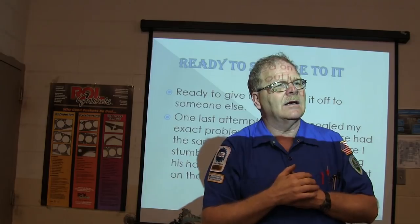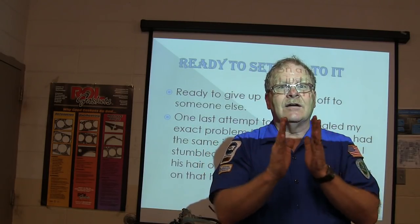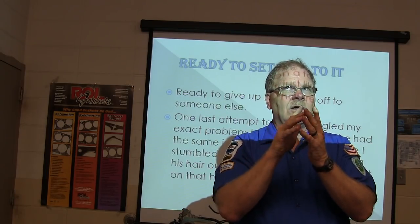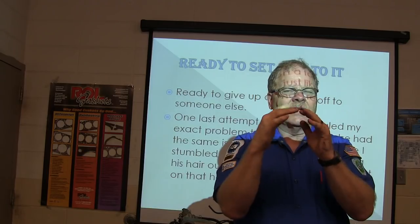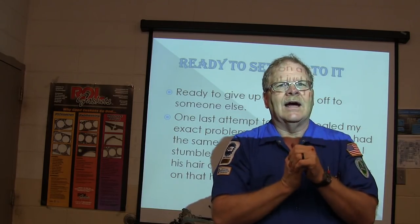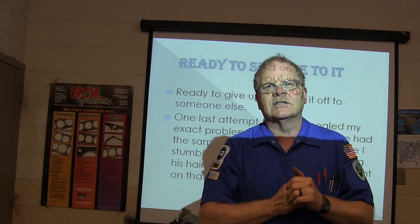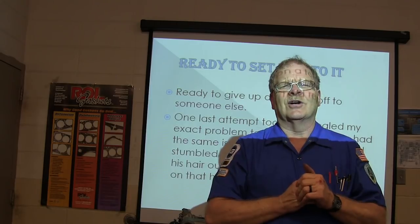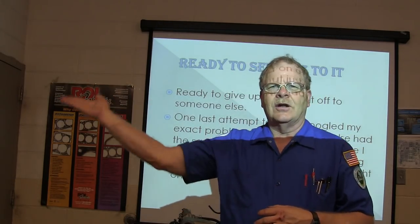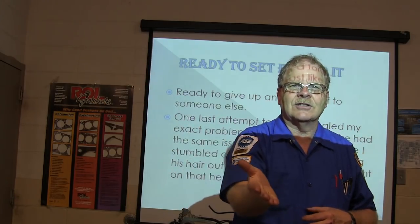You know why that's a bad idea? Because the innards of that coil are wired differently and the firing order is different. Now you can, if you know how to do it, extract the wires and put them in there in the right order, so as to make it run right. But if you just plug the wires in, it's going to kick back, it's going to pop, it's going to snort, it's going to not start. And on the Mercury Sable out there, if you took the Mercury Sable ignition coil and put it on the Ranger, it wouldn't even start. And if you put the Ranger one on the Mercury Sable, it wouldn't even start.